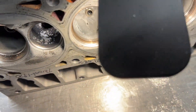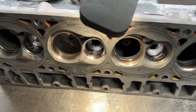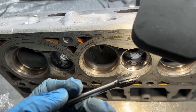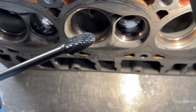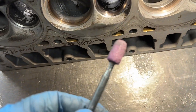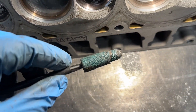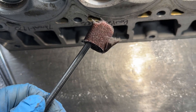From this point all you have to do is make it look pretty. This is the reverse taper I left off with. If you want to make it look nice, you use a cross-cut burr like this on the short side - it makes it smoother. Then I go to a pink stone like 24 grit, next a 60 grit ceramic cartridge roll - you get this from cylinder head abrasives - and finally I'll finish it up with a flap wheel, also 60 grit.